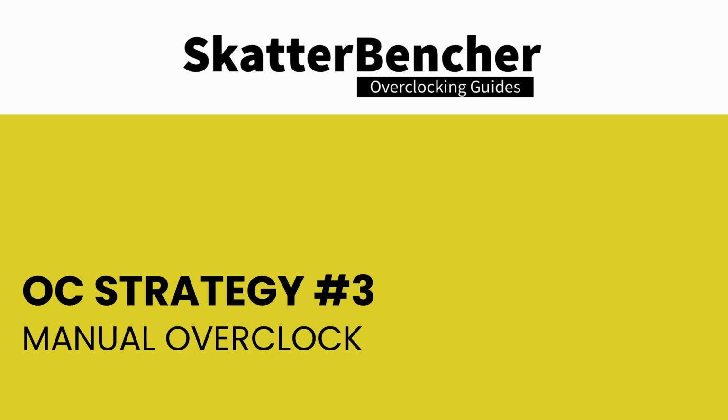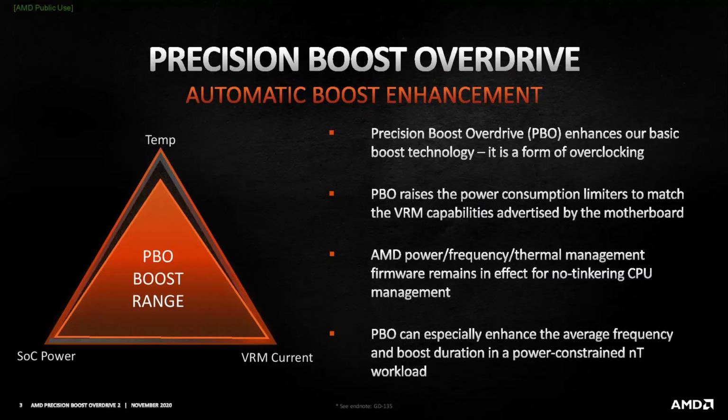We'll focus on 4 different performance vectors: CPU core frequency, graphics frequency, memory frequency, and fabric frequency. Before we start though, it's important to know that AMD has 2 overclocking modes: Precision Boost Overdrive and OC mode. The first mode you already know, it's Precision Boost Overdrive. This mode allows the user to change a limited number of parameters that are included in the Precision Boost algorithm. However, it is still the AMD Precision Boost proprietary algorithm that will eventually determine the performance of the system.